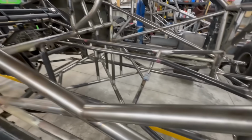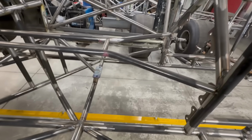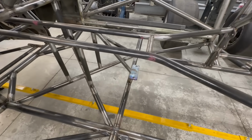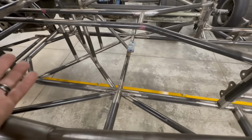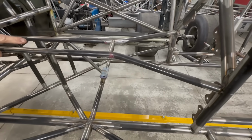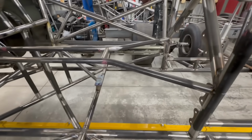Right. And then the ones that we need to take off, so like the stuff in the middle, that's going to get individual tabs, because I'm going to try to run a pan underneath the engine individually up to the front. And this right here will all be one big pan that you don't remove. Right. Just the center of it will remove. Because we're not going to need to take any of this. And I need to run individual tabs on the top. We're going to mount the piece of sheet metal over here where your driver's compartment is.